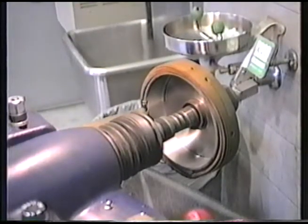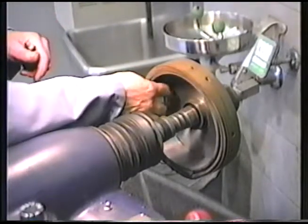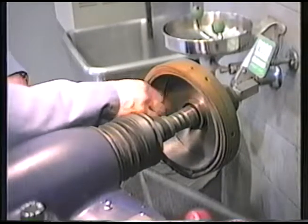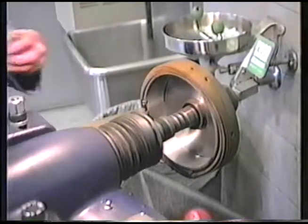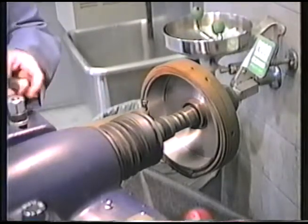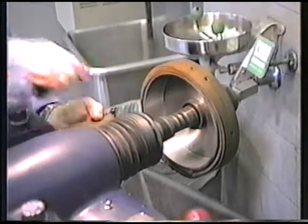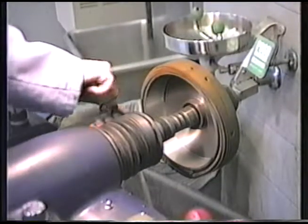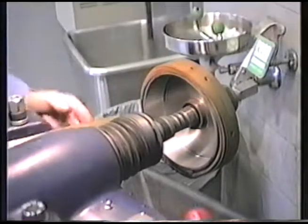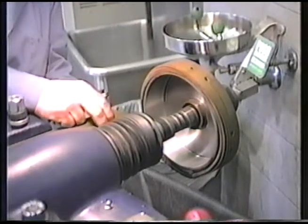Now on these small drums, if it's absolutely necessary to get in at the very edge here and the very edge here for the other friction surface, you could do that using the standard boring bar. Loosen it up, take the tool bit out, and actually you can turn the boring bar upside down and put the tool bit back in there, like so.